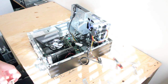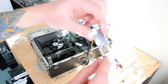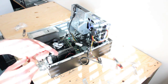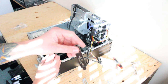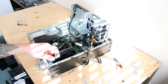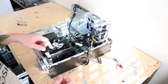I just spent way too long fidgeting around. It turns out that this bracket has the VGA porthole on the lower part of the bracket, and this one has it on the upper part. The ribbon cable is kind of short on this card, so luckily I have this other bracket. If your ribbon cable for your VGA port is kind of short, you might want to look for a small form factor or low profile bracket like this.